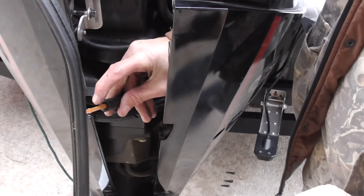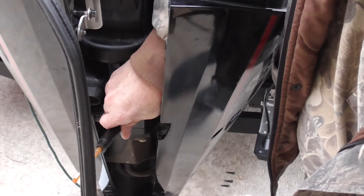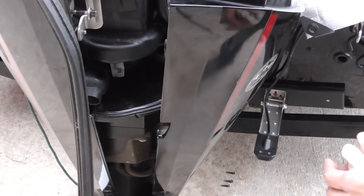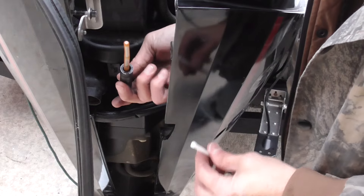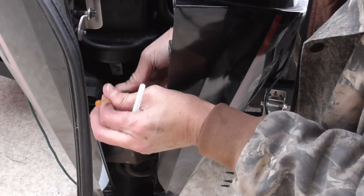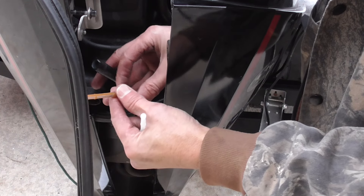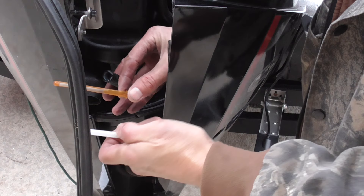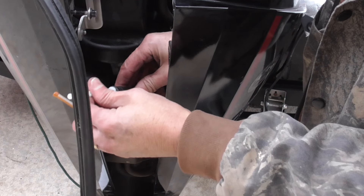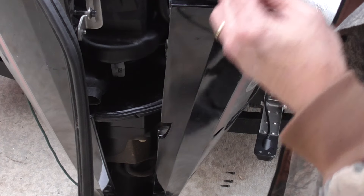And this is what we're after — this is the fuel filter we're trying to replace. That's what this whole effort has been for. It's only getting one drop of fuel, really. I'm going to set this aside, take the fuel rail and set that out of the way. Now I'm going to show you the existing fuel filter versus the new one. This just pulls straight up. You've got this one in your hand and the new one looks just like it. All we're going to do is put the new one down in this tube until it kind of stops — and there it is. That's what I'm calling the fuel rail fuel filter.